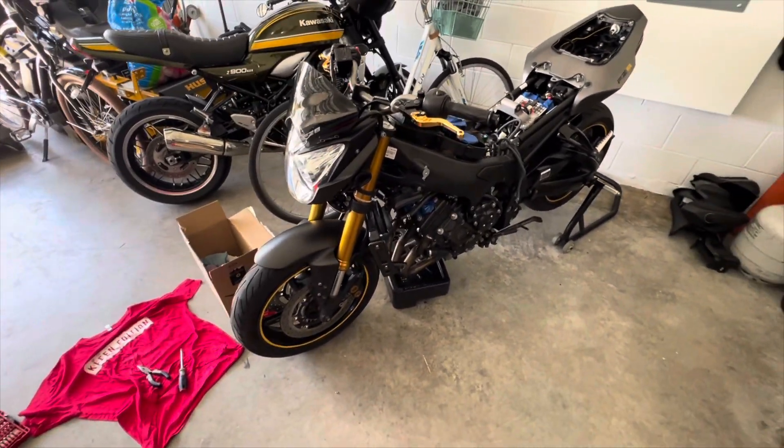Other than that, I put a brand new battery in it, so we're good there. I'm replacing the starter relay because that is bad in this bike — it just clicks. But other than that, it runs, it drives. When I rode it home it wasn't very happy about it, but it did clear up after a little bit.